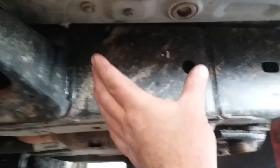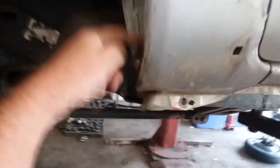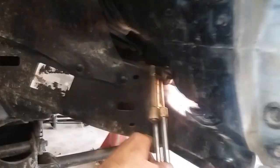We're going to move it back — take it off here and move it back to like here, so it's all the way back and nowhere near the tire rubbing. We're going to cut the fenders out and mop all this back in. To get around the top of the mount, we're using the torch.